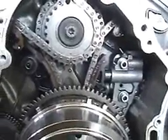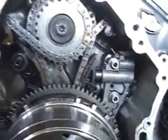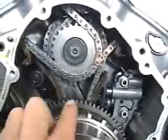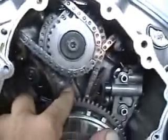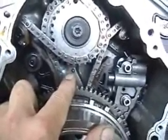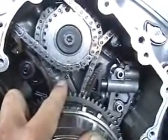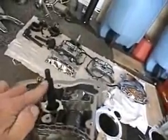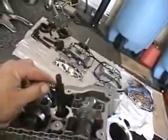Now I'm going to show you how to get the front cylinder at top dead center. Take your main crank and turn it counter clockwise. If you look right in here, you'll see a little tiny ball on the casting, and if you look straight up, you'll see a little dimple. That dimple and that little ball, when lined up, is top dead center — but you've got to make sure that you use your front cylinder. I have a top dead center tool; if you don't have a tool, you could use a pencil with the eraser end down. As you turn it counter clockwise, the pencil will rise — in this case it's the center pin on the top dead center tool that rises — and then I can lock it in once I'm on top dead center.